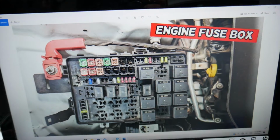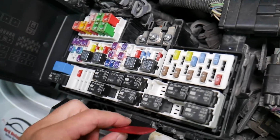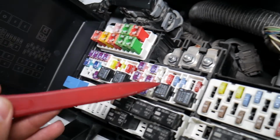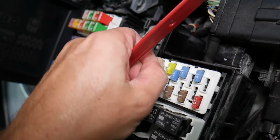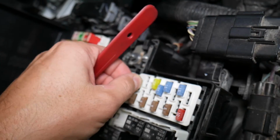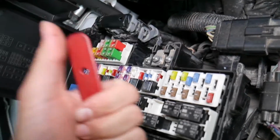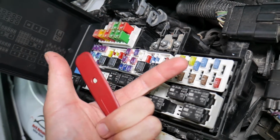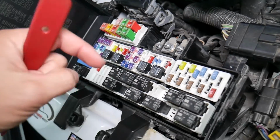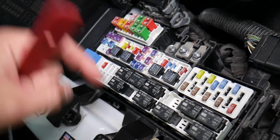Before we continue, let's explain quickly why it's always a good idea to test fuses and relays. It is very important to test fuses and relays. On those fuses you cannot clearly see if they're burnt or not, especially in the J-case fuses. If you remove a fuse, look at it and assume it's a good fuse, but it's actually a bad fuse, sometimes you cannot clearly see that. What can easily happen at that point is you put the bad fuse back in and start replacing parts and tools that you don't need to, so you lose your time and money to fix a problem that doesn't exist, when all we had to do was test the fuse and replace it. We'll put a link to a special video that will teach you how to test fuses and check relays very easily as well. Check it out, it will be in the description of the video below.